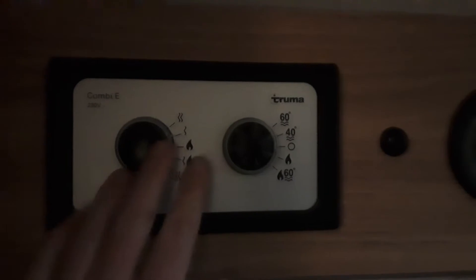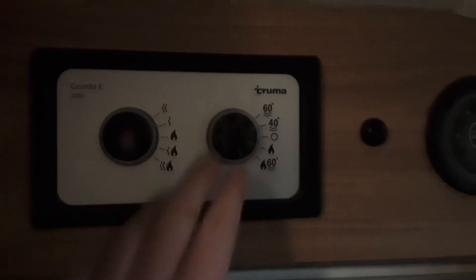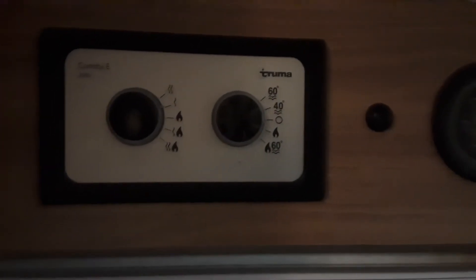Up on the side here you've got your controls for your heating and hot water, which I'll go through in a moment. The Combi boiler is on this side and the water temperature control is on the right hand side. First thing you're going to do is connect the water up on the outside of the van once the legs are all down and the van is stable. Then underneath the seat on the far side of the caravan, look for the yellow valve. When it's pointing upright, the water system is completely drained down. When that valve is flat and parallel with the floor, you'll be able to fill the water system.